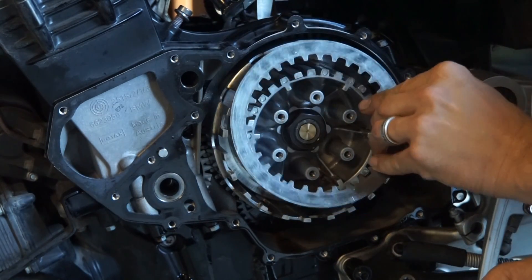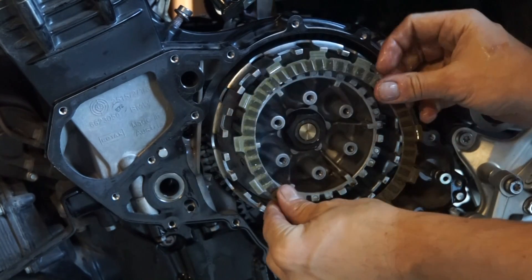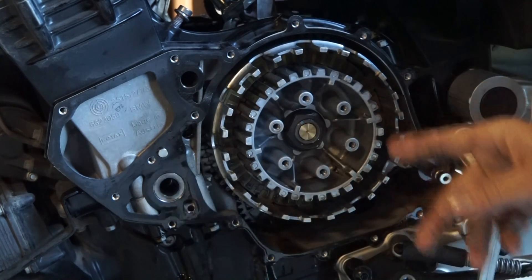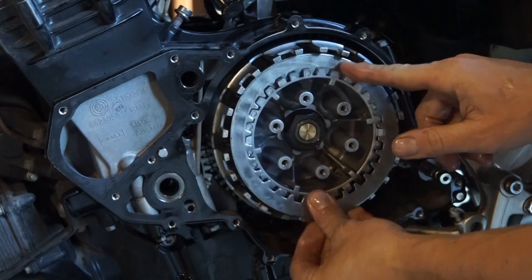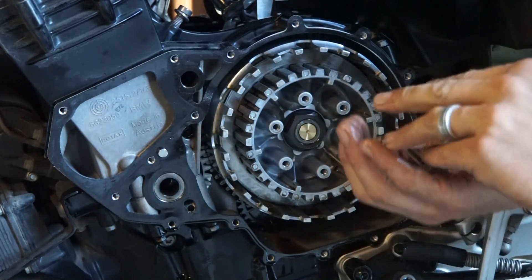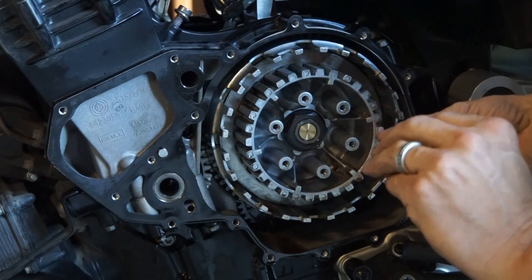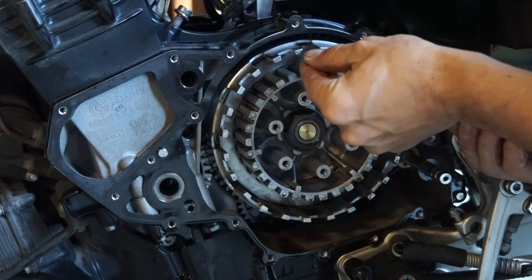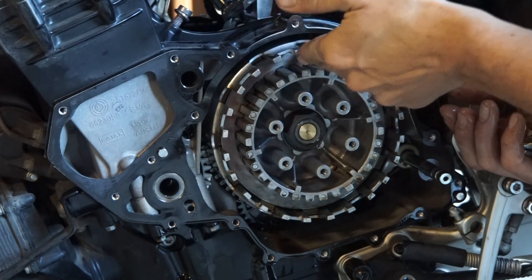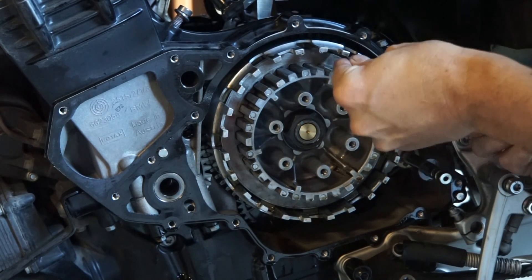Take a drive plate — the original drive plate — put that in, place the narrow tab fiber in, and follow that up with one more drive plate. Next, you'll have a whole pile of these basket sleeves, and these slide right in where the tab on your friction plate goes. Just place these each in, all the way around.